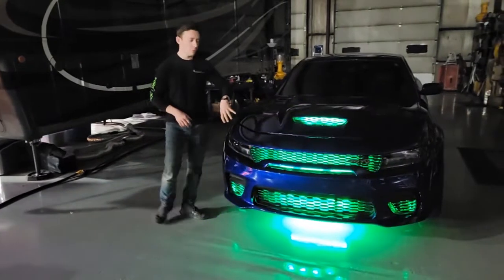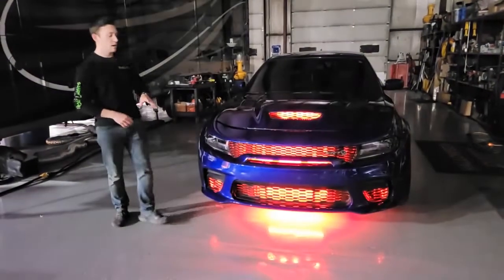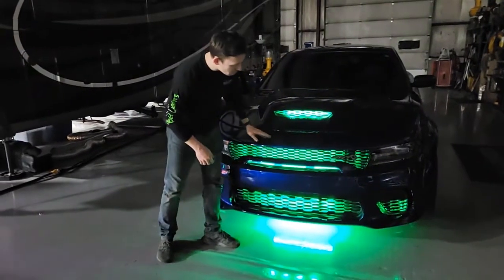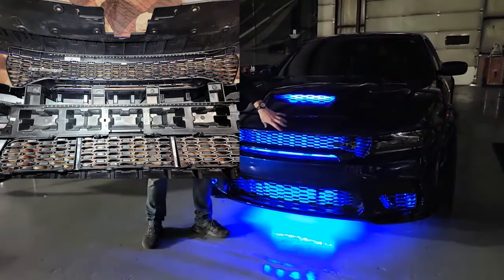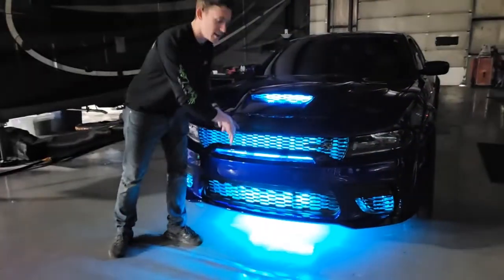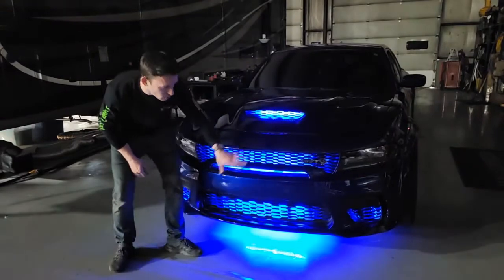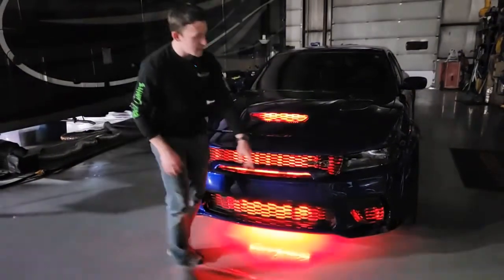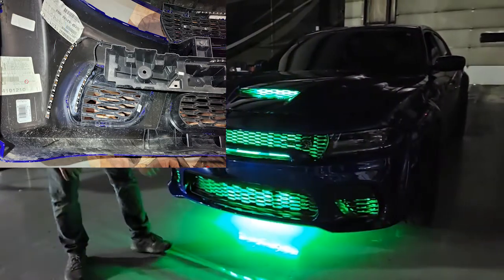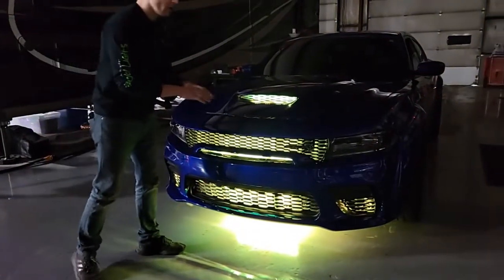The customer wanted his front grill as well as his front hood scoop completely lit up. So what we did is we put 14 feet of Boogie Lights inside that front hood and grill. We placed a two-foot strip on the top shining down inside this fairing, another two-foot strip shining down, then once you remove the grill there's a metal bumper where we put another two-foot strip shining up and one shining down — so a total of eight feet right there in the grill alone. He's also got some one-and-a-half-foot strips on each of those corner vents and another two-foot strip on the bottom shining down.